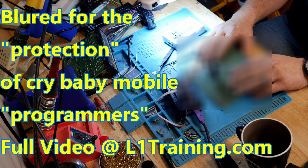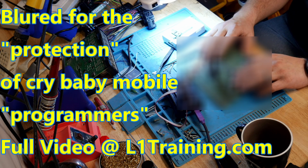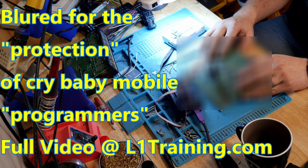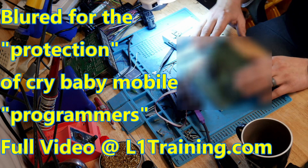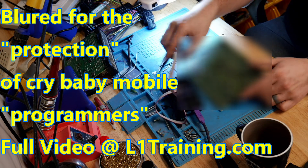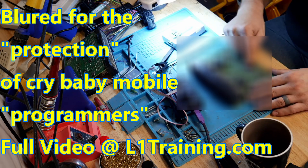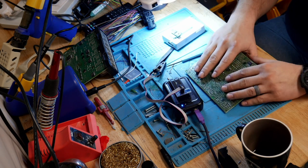So this donor should be a clone of at least the EEPROM data — the non-volatile memory stuff — including VIN, immobilizer, configuration data, all of that. Now, they already programmed this with SPS, so it actually has the latest calibration as well, and that information is going to be stored in the MCU.